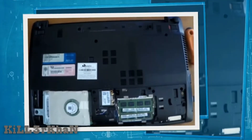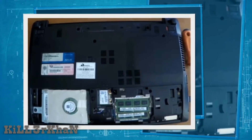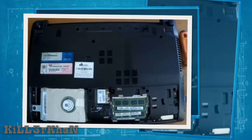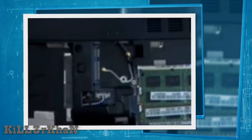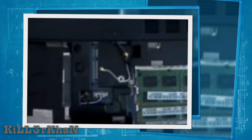I have an Asus K45VD laptop, for which I have removed the back cover panel to access the mPCIe slot. One concern is that many laptops only have one mPCIe slot, which is occupied by the WLAN card. You have to remove the wireless LAN card to use that slot for the external graphics card. In that case, you'll need to use Ethernet via cable or a USB wireless adapter.